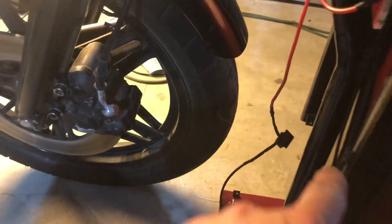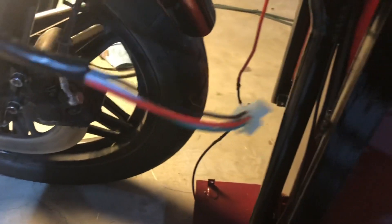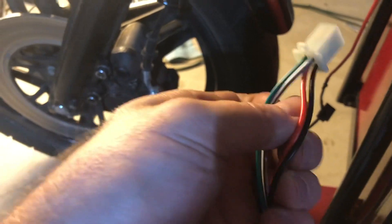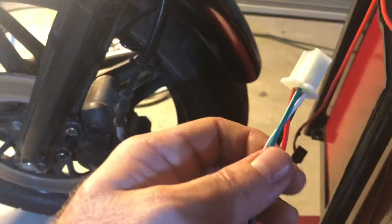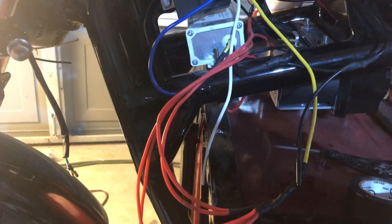All I've got to do ultimately is chop this off and stick on this key switch. It's a four-wire switch, but two of them are closed when it's in the off position and two of them are closed when it's in the on position. As I understand the wiring, you just need to connect these two - the black and the red - in place of the black and the red here, and when we turn the key on it should do the same thing. These other two wires we can just ignore - it's a super simple switch. Turn the key on, everything's active, and from there the switches on the bike control certain things.